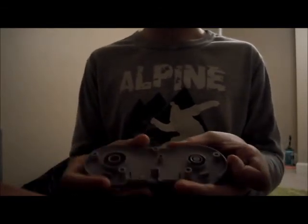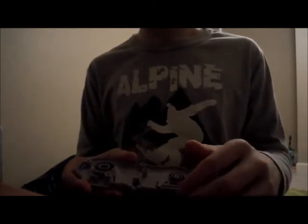What you're going to do is take the metal rods. You're going to go to your plastic side. We're going to do all the buttons now. Go to the plastic side, right here, and take the back buttons, the L and R buttons, and place the metal rods in on these pegs back here first. Now, facing towards you, find your left and your right and put the L button on the left side, making sure it's locked in right there and everything. Put the R button on your right side, making sure it's locked in and everything.